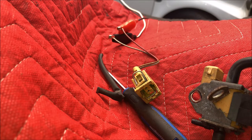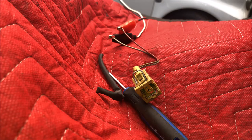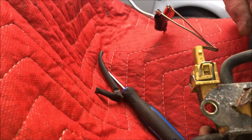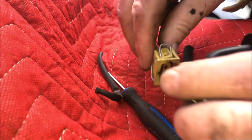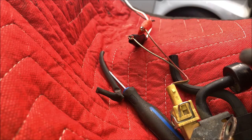The only thing I can now do is grab one of these other ones and see if there's any difference in the way that works. So where's my sucky tube? This one. Nothing. Excuse my sniffling, it's freezing out here. So now plug this one in and sucky tube again. Actually, that sounds a heck of a lot more open. Let's go back and do that again. Plug this one in. And this one sounds like it opens a heck of a lot. There's a lot more vacuum flowing through this one than this one.